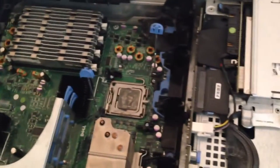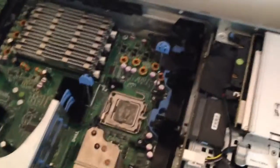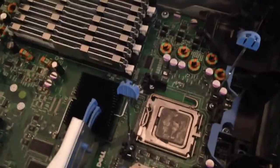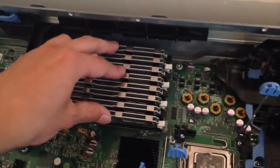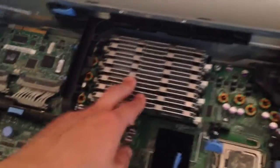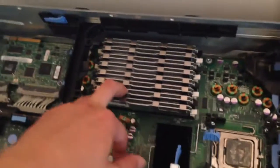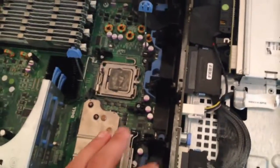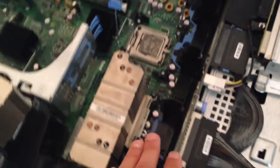And then just drill a hole straight through it. I have a couple concerns with this — trying to make these blocks, I don't know how good of an idea that is. Also the RAM: I have eight slots and this is 16GB total, so these are 2GB each, and I'm concerned that these are going to get too hot. Also my concern about removing these fans — I don't want to do that. I think whatever I'm going to end up doing, I want to leave these fans in here for cooling the hard drives and the expansion cards.